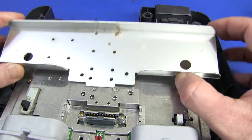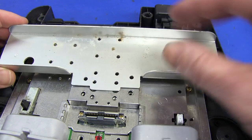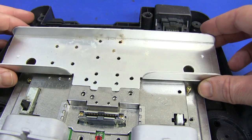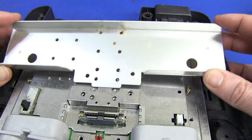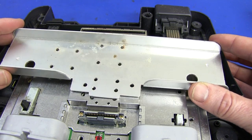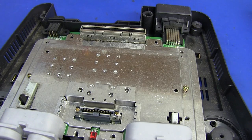And if this thing is a heatsink - and it certainly seems to serve no other purpose - they really haven't gilded the lily on it. They haven't gone to town with a multiple-finned heatsink, because it's all about surface area with heatsinks. They've just gone with a very basic folded form rather than a machined aluminium block, which is much more expensive in production. Maybe some compromise there - maybe the design team said they needed more heat sinking, and the bean counters said a black anodized extruded aluminium heatsink costs too much, so they went with a bit of folded aluminium instead. That's what they decided to go with.